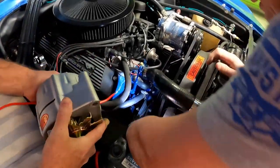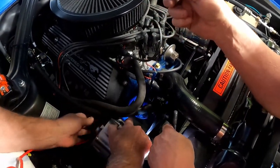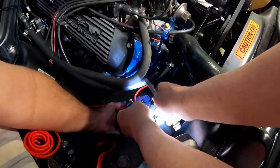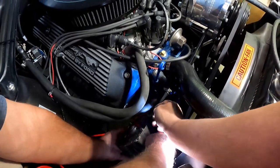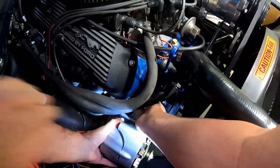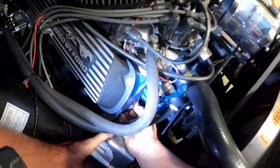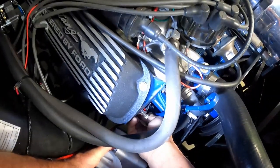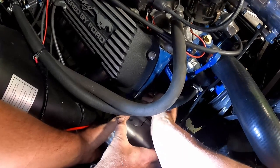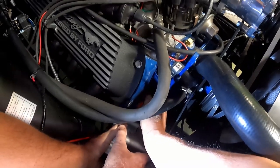Okay, so install the new one, which is just the reverse of the old one. And we got this, and we have a spacer. Where's the ground? I'll go ahead and put it on. Or it doesn't matter. It was this one. Here. Put it on, cinch it, and then... Yeah. Slide the alternator up into place. Let me get it on there for started first. All right, you want that under all the washers? That was the only ground wire on there, right? Yeah, but the wiring harness had a ground wire. Right. And that was the only wire. Yeah. Okay.